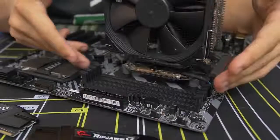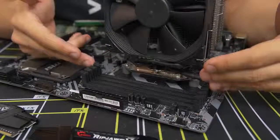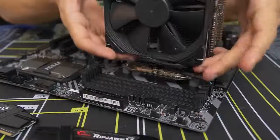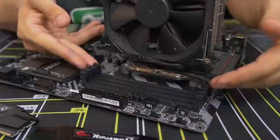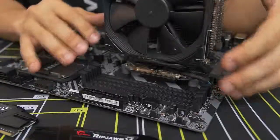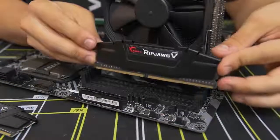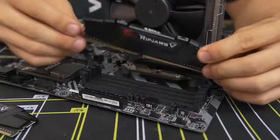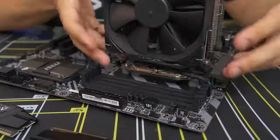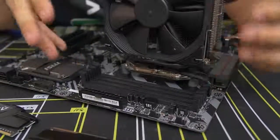This cooler is fairly slim, so we're not running into any clearance issues. But you might have one that's too large and encroaching on the leftmost DIMM slots. If yours is only blocked because there's a fan on the side, you should be able to pop the fan off for more open access to those DIMM slots. If there's no way around it, it's possible you've got incompatible RAM that's just too tall — the heat spreaders on the RAM are just too tall for the model of CPU cooler you've purchased. Look into that online and do some research before sending things back.